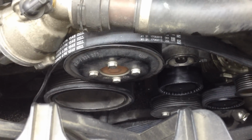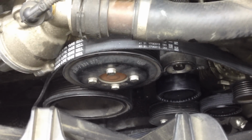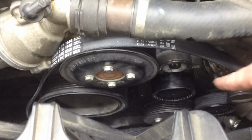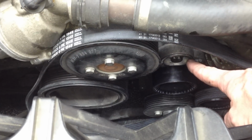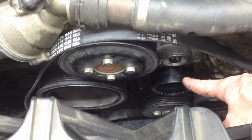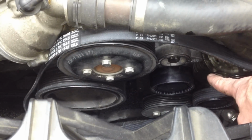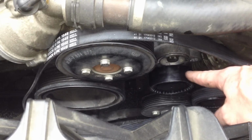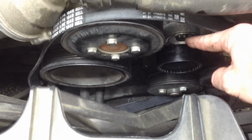Okay, guys, as I've learned fixing this, it's always good to retrace your steps. And look at the way my pulley is sitting right above this one here. This is how it's supposed to look after it's been tightened. So correction, I pulled my pin and the pulley was way over here to the side. Well, the pulley needs to be right above this other one right here, so it needs to be vertical.